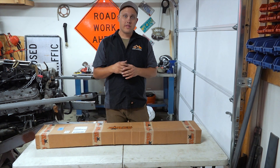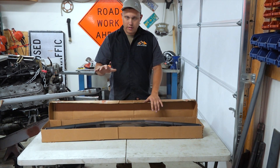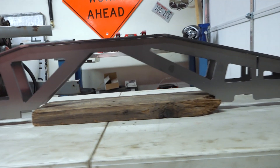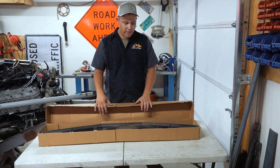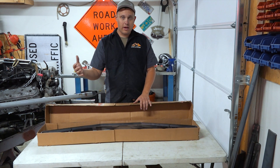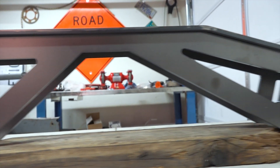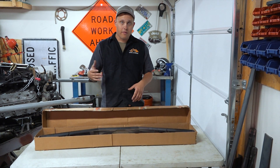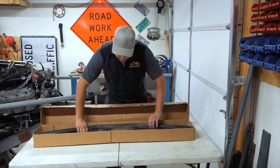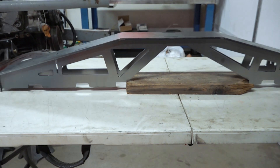I've got a couple more things I want to show you. One of them is the rear axle truss — I'm using a matching set. For my rear axle I'm using the Pro Series GM 14-bolt full-width axle truss. This one in particular is for a single rear wheel axle, which is what I have. This is also made out of quarter inch and 3/16 ultra 100 steel, which is designed to be light yet incredibly strong. They use more or less the same design — the same tab and slot method so it jigs right together. You can mock it all up before putting it on your axle, and then you just do some prep work and weld it on. It looks very similar to the front axle truss, which it should.